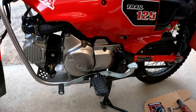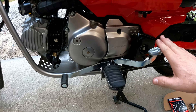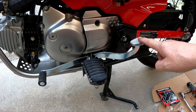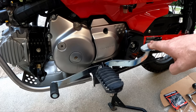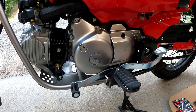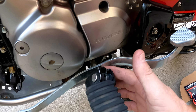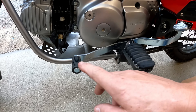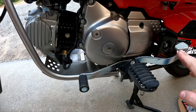If you have a CT125 you'll know it has a heel-toe shifter. I wear Forma adventure boots and on a long ride I can accidentally hit the heel shifter. If I'm in fourth gear and accidentally push down on that, it'll make the clutch slip - that's definitely going to lead to premature clutch failure. A lot of people just cut the heel part off, which is a great thing to do. Also, there is a recall on these shifters - mine's been done - apparently they break somewhere at the weld.